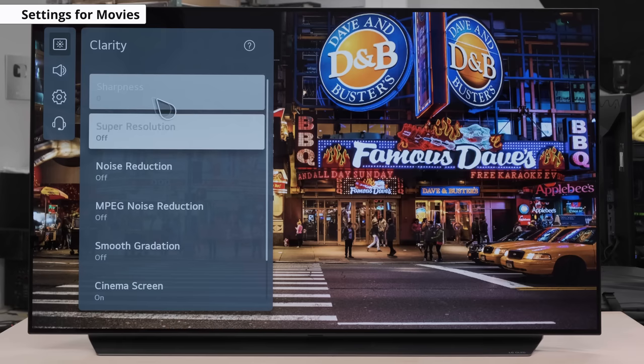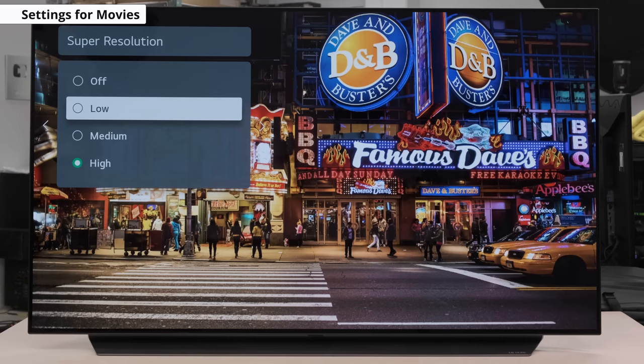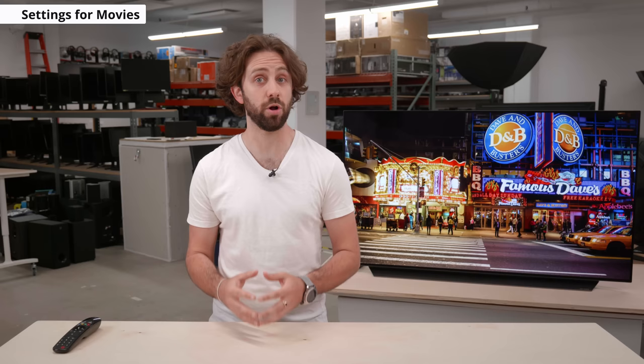The majority of our tests are conducted with super resolution, noise reduction, and smooth gradation disabled, but you can go ahead and adjust these to your liking as well. Super resolution adjusts the screen's resolution to make dimmer or blurry images more clear. Noise reduction is a feature where the LG C1's processing tries to find imperfections in the content you're watching and auto-adjusts to fill or smooth out the scenes. Smooth gradation is a setting that increases processing on gradations — basically how finely levels of color can be displayed when viewing content and how the colors gradually change from one to the next. It matters most when you're looking at details in shadows, the sky, or in skin tones, and tends to matter most in HDR content. Since there's some processing going on, a lot of movement or too much info on screen can cause small artifacts and issues in color, so do keep this in mind when enabling it.